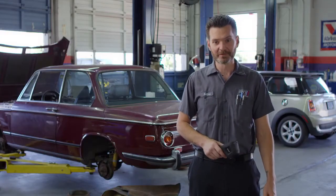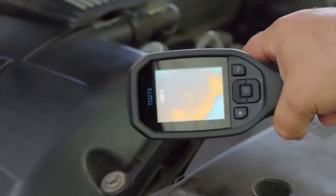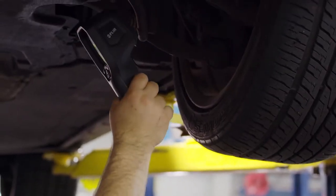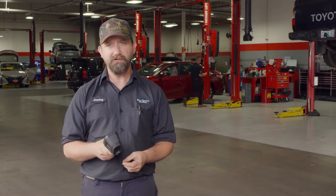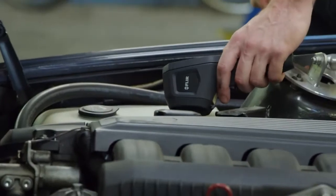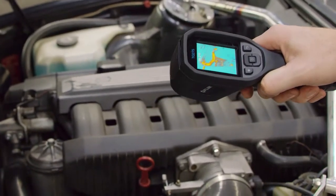So far the most useful thing I found to use the TG275 is checking air conditioning systems, cooling circuits, and looking for engine misfires. The FLIR gun was a great tool. Most of my technicians here at Ron Tonkin, they were using them for wheel bearings. A couple of them used them for the heated seats — we had a couple of heated seat failures, worked great for that — as well as some injector issues. They were able to pinpoint a bad injector with it. In a motor, if it's having high resistance, you can see the actual temperature arising, and sometimes you can't feel it if you were to touch it. So being able to see high resistance, either mechanical or electrical.